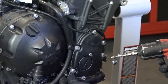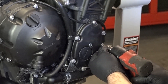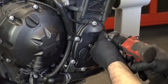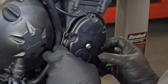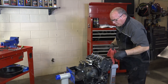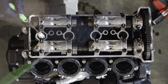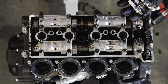Just make a mental note of where each one of these little brackets are, otherwise you'll have to rewatch the video to see where they went. That's actually called the pickup rotor cover — there she comes, and there's your pickup right there. We're getting ready to bring it around to top dead center, but the spark plugs are still in it, so let's go ahead and get those pulled — that way it'll be much easier to turn it over. Looks like this one's burning pretty clean. All those look good, nice and even.